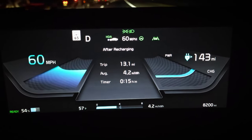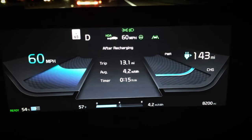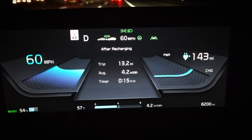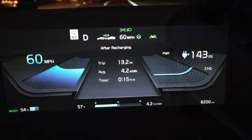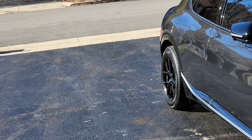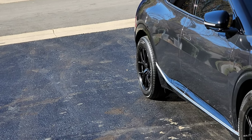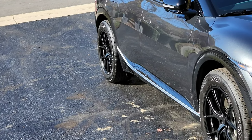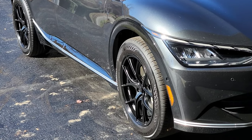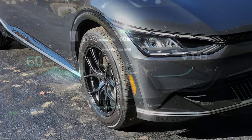It's undeniable how close it is with the stock wheels compared to these Titan 7 wheels. I think the fact that these wheels are forged and very lightweight has to play a part. I also think that while they're not aerodynamic, they're not as bad as some wheels — for example, they're fully concave, so no part of the spokes extend out past the tire. Some wheels out there to get a concave look have spokes that kind of curve out and that would be even less aerodynamic. But I think the weight is the biggest factor here.